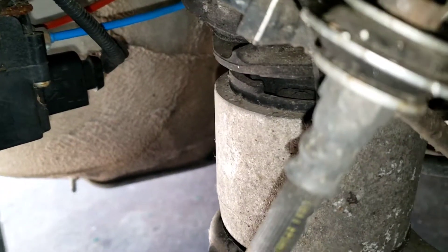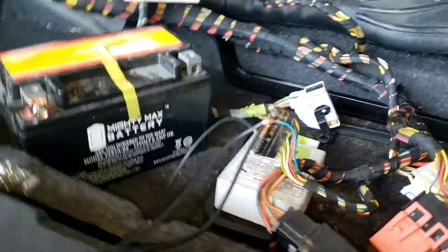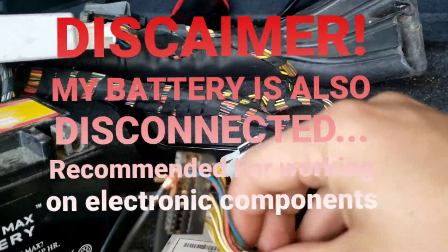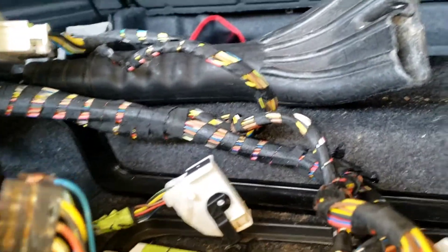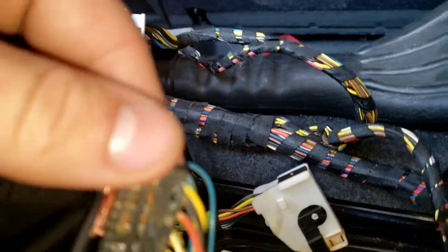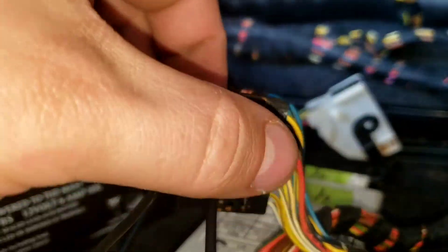You could come in here and cut wires and mess with all that if you want, but I didn't want to cut this because I might get the module and replace the stock system. So that wire comes up into the wheel well, comes into this loom, and comes all the way down here. This is the plug — I pulled it out of the white housing — and this is the plug that your module plugs into. My module is bad. The three cables down there are the blue with gray, the blue with black, and an orange with a brown line. The orange with the brown is your negative and the two blues are your positives — positive for the left and positive for the right.